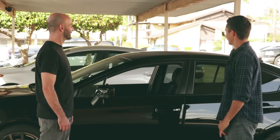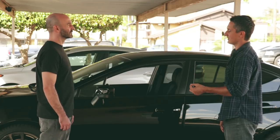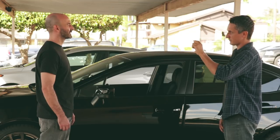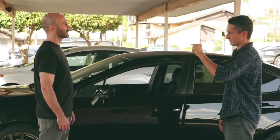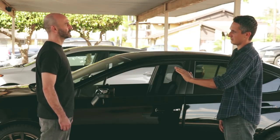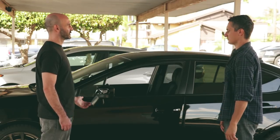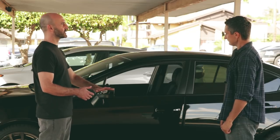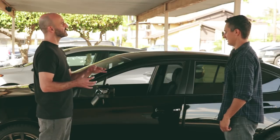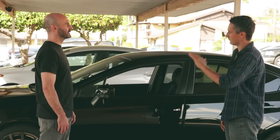In my car I use the stopper all the time, and the few times I had to take it out to do revisions I couldn't even drive the car honestly. The pedal has a sticky feel because of the helper spring — when you first press the pedal it compresses the spring and then it pushes back out, so the pedal feels like it gets glued to the floor. It's super odd. When the clutch is fully depressed and extended all the way out, it feels really inconsistent.